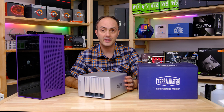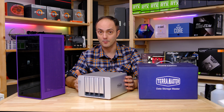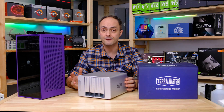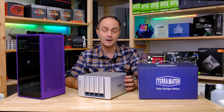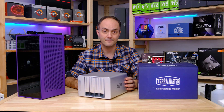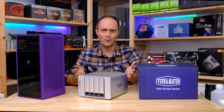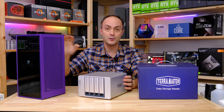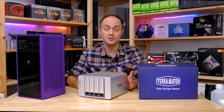There are a couple of ways around this. Number one is to use a motherboard with a 10 gigabit network port, but those don't exist on Mini ITX motherboards — at least consumer boards — at the moment. The other option is to use the Thunderbolt port on some motherboards. There are Mini ITX motherboards out there that have Thunderbolt; Intel's new Z590 chipset motherboards will have plenty of them with Thunderbolt. Thunderbolt 4 is pretty much the same as Thunderbolt 3 coming out with Z590, and using a Thunderbolt to 10 gigabit network adapter is, for Mini ITX, pretty much your only option for getting 10 gigabit networking.